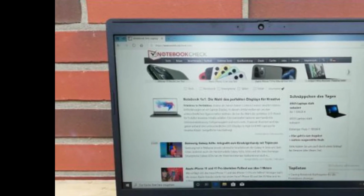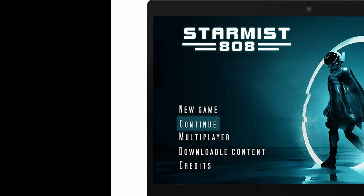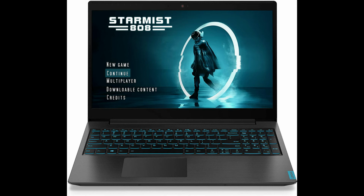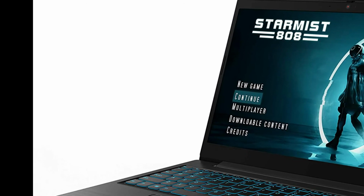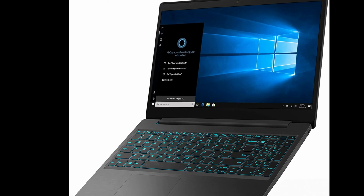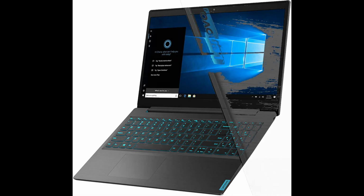Energy management, gaming laptop with good battery life. Energy consumption. Our measurements show that the IdeaPad L340 15IRH Gaming has a power consumption of at least 3.8 watts when idle and up to 124 watts under load. On average, it is therefore more economical than the other laptops in our test field and exhibits the lowest energy requirement, especially under maximum load. The included power adapter provides an output of 135 watts and therefore has enough capacity to be able to supply the Lenovo IdeaPad L340 15IRH Gaming reliably with energy.